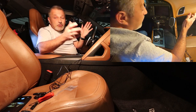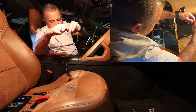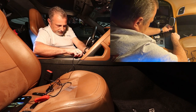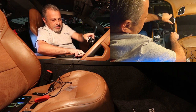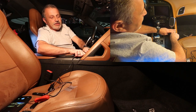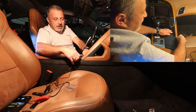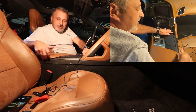Now probably the trickiest part of this whole thing — which I don't really think is too tricky — is making the wiring look nice. There are many different ways to go about doing it. I've figured out I can give myself a little bit of room here so I can turn the phone if needed. Like so — that's enough room to turn the cable, but it also stays nice and tucked away so nobody's going to see it. It tucks right up against this wall. This little handle will push out just enough that you can tuck the wire down in and around, then run it right up alongside here and up inside to the cigarette lighter.